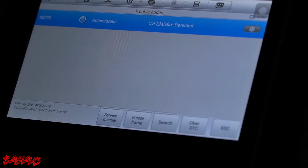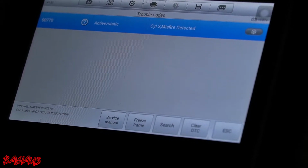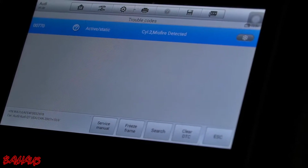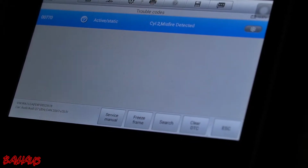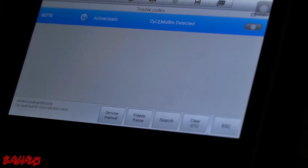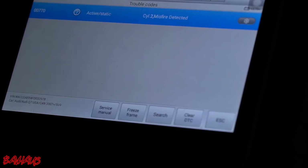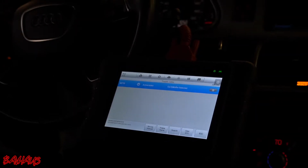We're going to get into figuring out what could be going on now. We're kind of down on temp, and I want the temp to be hot, so I'm going to go run this thing around until it reaches temp again. The next step is going to be looking for valve train issues, and the way we're going to do that is by doing a compression test on every cylinder and comparing them, and I'll explain what the numbers should be and how they should relate to each other when we get there.